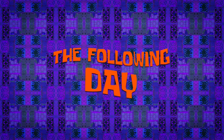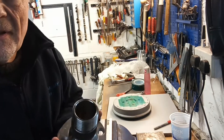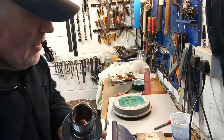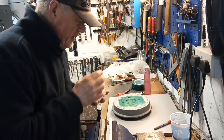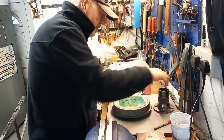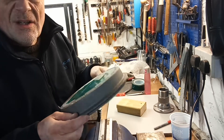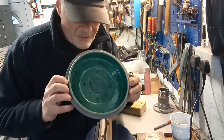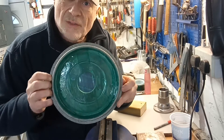The following day. Nice, isn't it? That's beautiful - love these. What are we doing today? We are doing some more masking, this time we are doing the brake drums. Important thing about brake drums - you can't powder coat the inside, or you shouldn't, because it wouldn't work very well. So that's all masked off now inside.